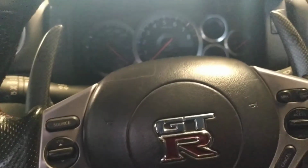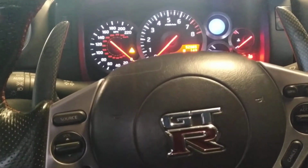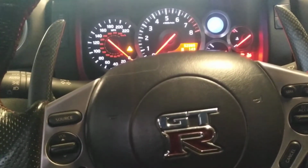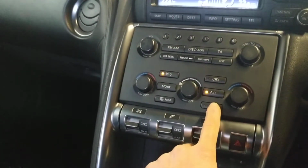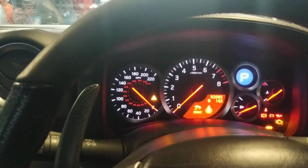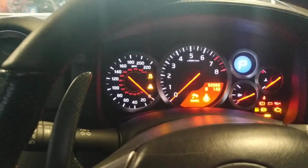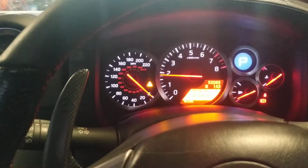So basically ignition on, wait for about 5 seconds for the CAN to wake up on this particular vehicle, and then insert your push sequence. So we've done something simple. So 4 button presses here. So 1, 2, 3, 4. Double flash from the indicators. Foot on the brake. Start the vehicle. Really clever, really straightforward.